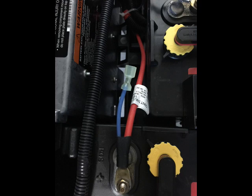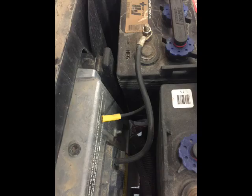In this video we will refer to this post as the main positive. Here is a picture of the main negative cable on a PD-1, PD-2, PD-3 system or an IQ system — please note the main negative goes through the onboard computer on this vehicle. On the new ERIC vehicles, the main negative cable does not go through an onboard computer; that cable goes to the controller at the back of the car.